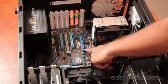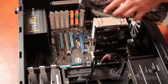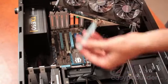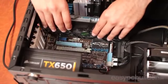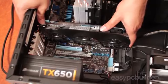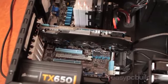The slot on the motherboard has a notch which you need to either push down or to the side before installing the card into the case. You need to push this down prior to removing the card if you ever need to uninstall it from the case. So now we're going to bring the card in for installation. Remove any items protecting the interface pins, ensure the graphics card is installed level and upright, and you'll feel it click into place and seat on the motherboard. Install your 2 screws to retain the card.